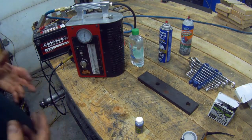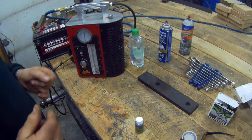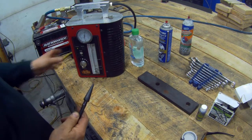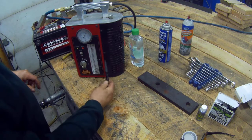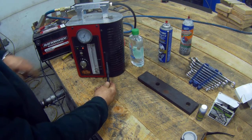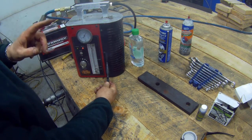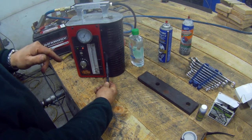So what's this about the dye? Because you've got two strings to your bow with this thing — you've got the smoke and you've got the dye. So I'm going to fire this up now and show you what you can do with it. Simple start, it's got a timer in it — that's what sets this a little bit different. You can see the smoke coming out. So if you have an engine and you want to find out where an oil leak is, you simply put this down your dipstick hole and it will fill the crankcases full of smoke.